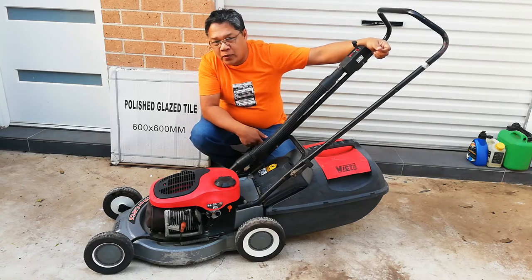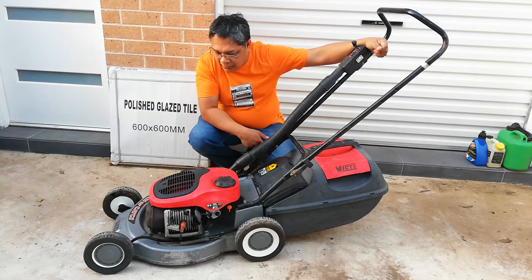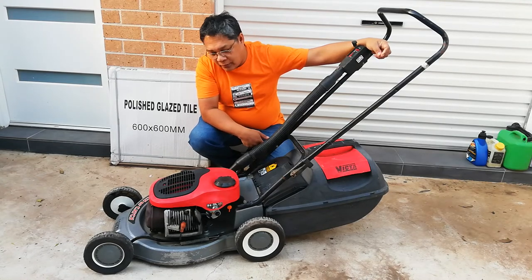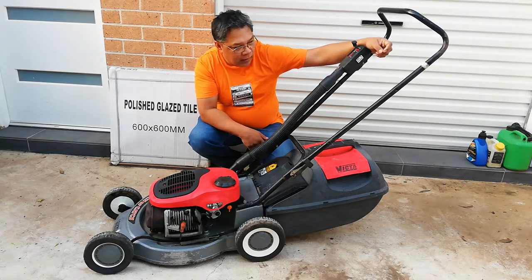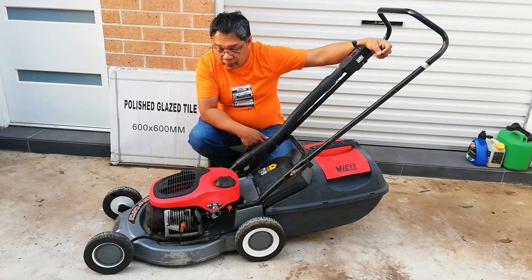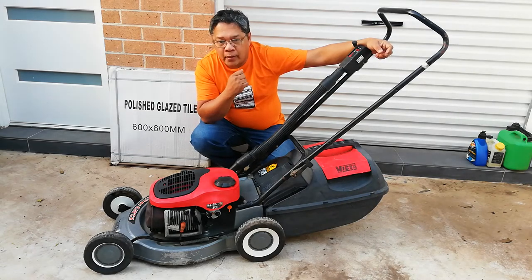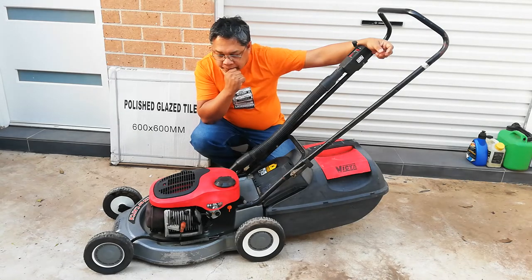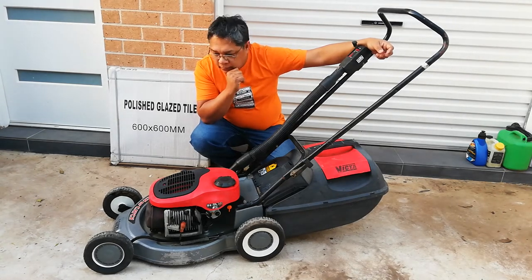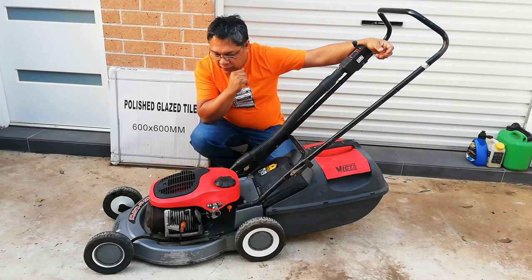So I found this one in my pile and it was really, really dirty. I spent the whole day yesterday to fully clean it and fully rebuild the carby. The old carby primer cap had already worn out, so I replaced it with my modified primer cap. I also fitted it with the metal needle — it's one I actually designed, and it's now on the market, which is really great. It's a great modification.